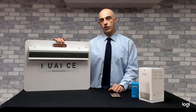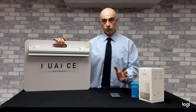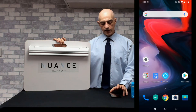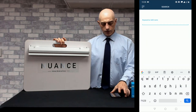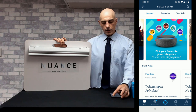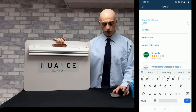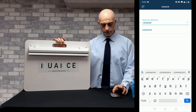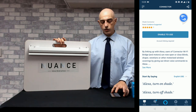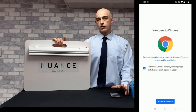The next stage is to install the hub with Alexa so that you can voice control these devices and open and close them with a simple voice command through Alexa or Google Home. On your smart device, go to the Amazon Alexa app. Go to the menu at the top and choose Skills and Games. In the search box enter connector as the name of the skill. It should be the first one in the list. Select the connector app and choose enable to use.